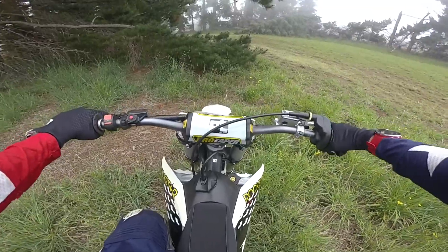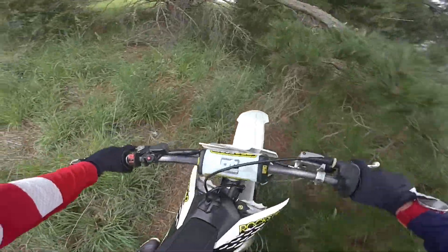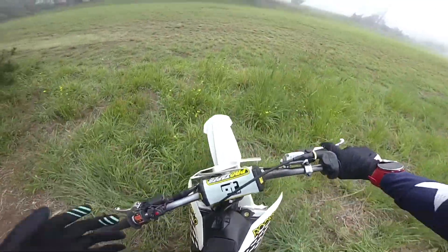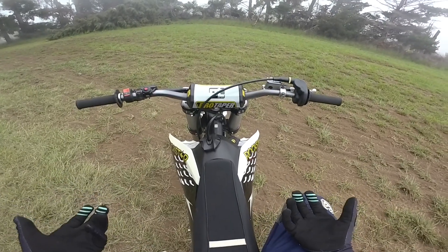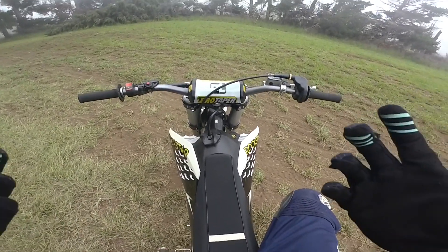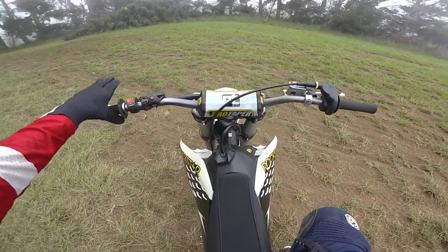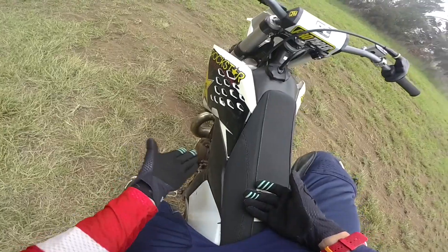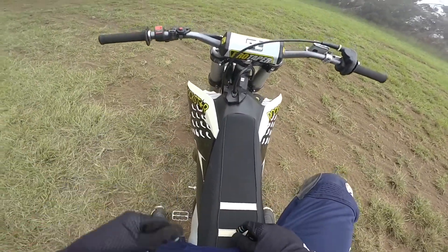Super cool — that's why this thing is really good in technical terrain. If you don't have perfect modulation in your hand anymore, you can still do tight maneuver stuff. People ask: is it fully automatic? Do I still have to shift? Yes, you still have to shift. It is a normal dirt bike — you just don't always have to use the clutch to keep it from stalling. Your shifter is still there; it does not change the gears in your transmission at all. All it does is turn the bike into a semi-automatic.